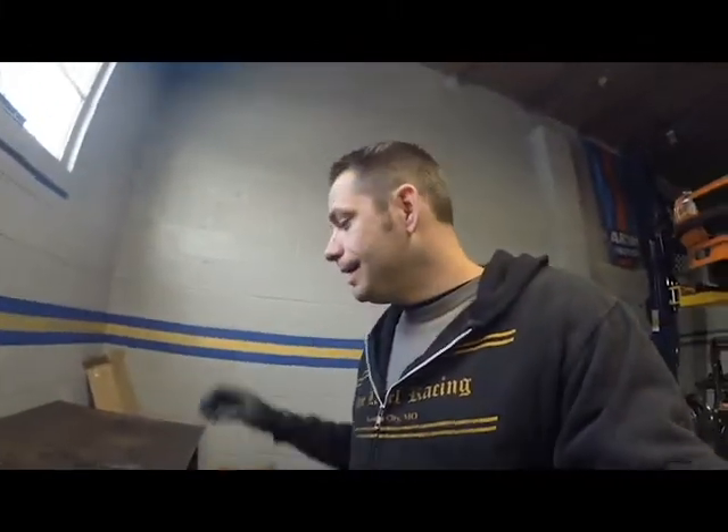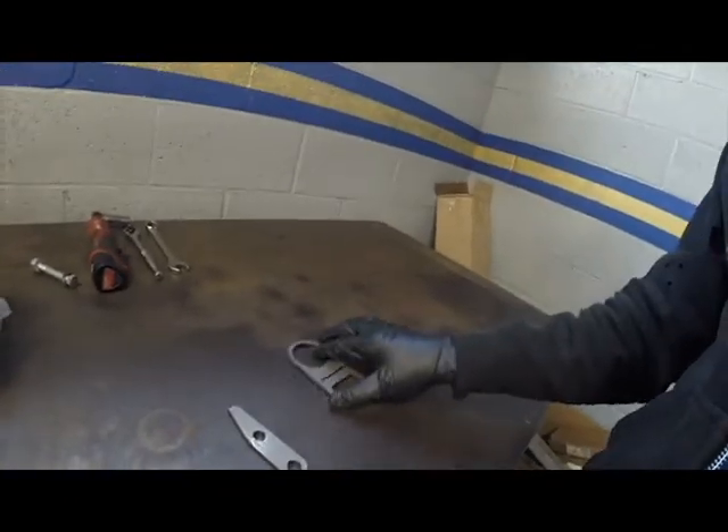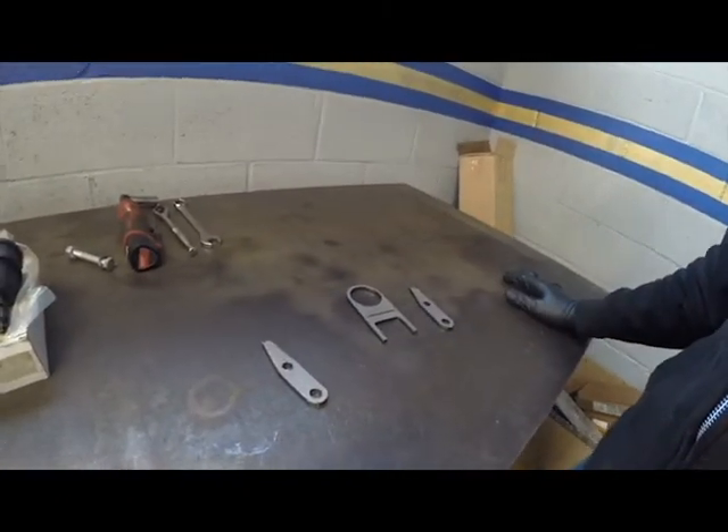Just like that, we're a few days later. Now we've got a couple of the other parts we've been waiting on in the shop. We're going to make the ball joint adapter for the bottom, since the ball joint on the Corvette spindle is bigger than it is for the Ferrari spindle. These are pieces I got cut from the online company OSH Cut that I've been using. They're quite good at getting the specs just perfect as long as your DXF file that you send them is accurate.